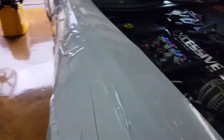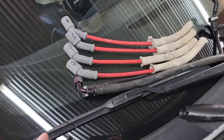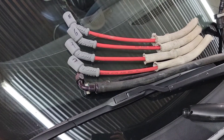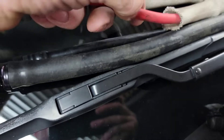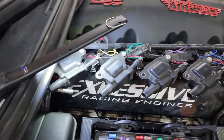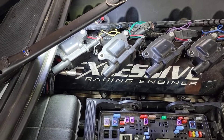On the right bank, all the plug wires are pretty decent. There's no burn through or arc marks, but it looks like someone took a pair of pliers or channel-locks or something and tried yanking on them — it's got teeth marks in it. Number six and number eight were on the spark plugs on this side, but they were not completely seated — tuning issue.